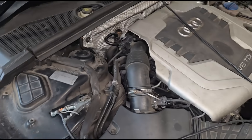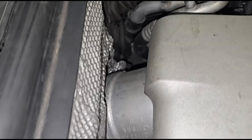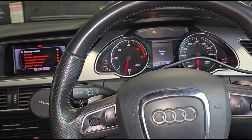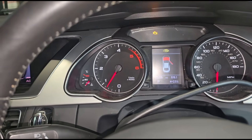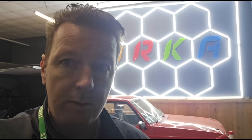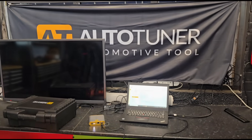Skipping a few minutes onwards — the file has been loaded into the car. You can see it's got a DPF on there, but that is not a new one; it's been spray-painted to look like a new one. Now we're back in the car starting it up. We have got an engine fault on the car — an engine light on and a flashing glow plug symbol. That means this car has still got a fault somewhere with the DPF, so either there's a fault with the sensors or a fault with the actual DPF itself. We're not 100% sure yet whether the DPF has actually been replaced, but we are in the process of having a stock file put back on the car.